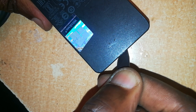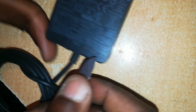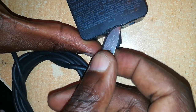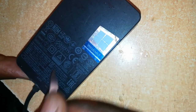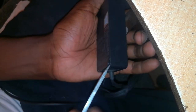To start everything off, I probe the edges of this charger with my razor blade and look for any weak spot along the upper edge. You'll see there is a joint here. I've found that there is a weakness here, and I pushed my razor inside — assisted by hitting — and I found that open, and I've started opening it. I'm going to go around and open this slowly until it all comes out without any breakage.